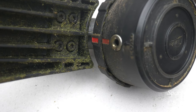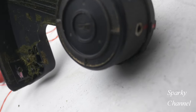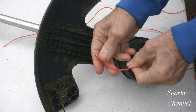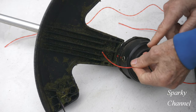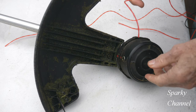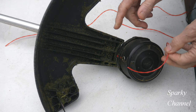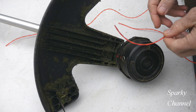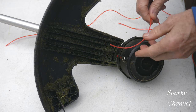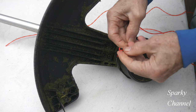Now what we're gonna do is line up these red stripes right here — there are red stripes on both sides. I have some Milwaukee string here. This is .080 string; you can put up to 25 feet of .080 string in this trimmer. It can also take .095, but you can only put 20 feet in the head, and it can also take .105, which takes 15 feet.